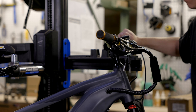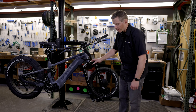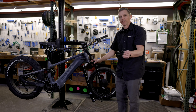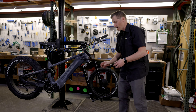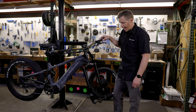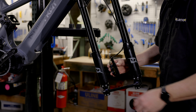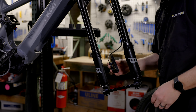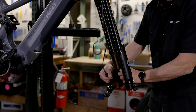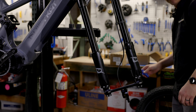Next up for our 2023 Ibex is to install the front wheel. Most of these will ship with a shipping plastic on the fork just to help protect it during shipping — we'll set that aside and won't need it again. Once that's removed, we're ready to remove the front axle and install the front wheel. As you can see, the front brake is just hanging free — it was all wrapped up for shipping. The bolts you need to attach it to the front fork should be in the fork itself in the brake mount.